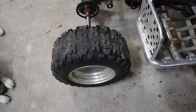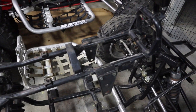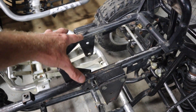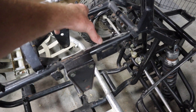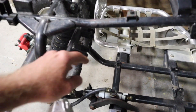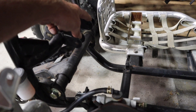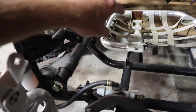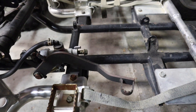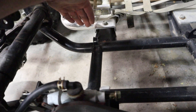These are 16-inch tires and I'm hoping to go up to 18s to give a little more ground clearance. Because we don't have a gas tank — which normally sits in this area — this is the perfect place for the controller. The controller has fins for cooling, so we'll just put the fins down, make some brackets, mount it up, and it'll get plenty of airflow. I'm actually going to be able to reuse these upper mounts with some custom brackets for at least one of the motor mounts. Test fit confirmed the sprocket lines up perfect, bringing the edge of the motor right over here — should be no issue.